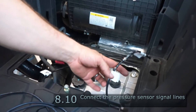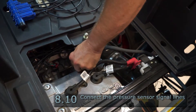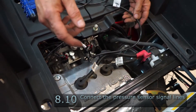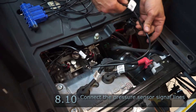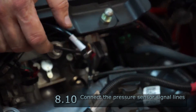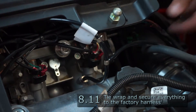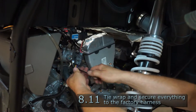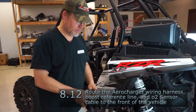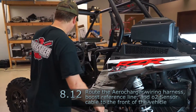The air lines off of our new MAP sensor are marked. Take the one that says 'manifold' — it goes to the fitting we drilled and tapped into the throttle body. The other one will be for your boost gauge, with a separate line running from the boost gauge back to that T-fitting. The other end of that goes to the blow-off valve. Tie wrap this harness up to the factory harness where it's out of the way, not touching anything hot or rubbing on anything. Then get our connector cable for the AFR gauge and oxygen sensor, and our boost signal line, and run them together with the fuel controller harness up the rocker panel and into the cabin.